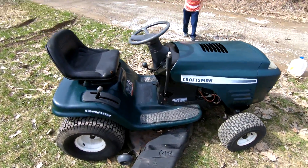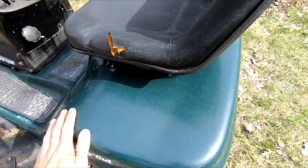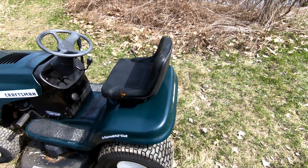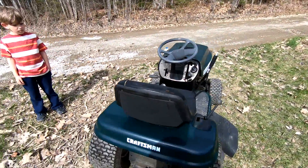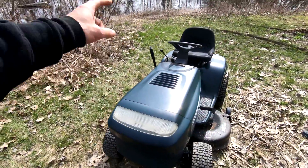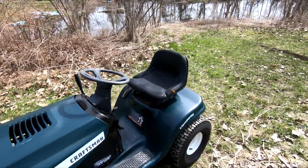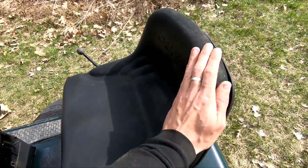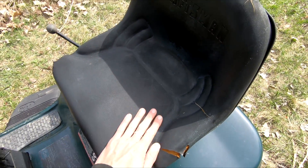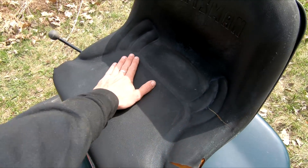With a little spit-shine and polish, it came out pretty decent. When dealing with paint this far gone, I go over it with Simple Green and scrub out every bit of mildew, then go back over it with a wash-and-wax mix from AutoZone. I'll also use tire polishing spray — usually 3M because it's cheaper but works really well and takes off all the mold buildup.